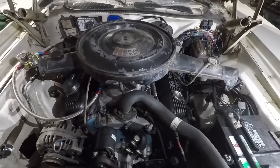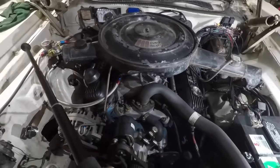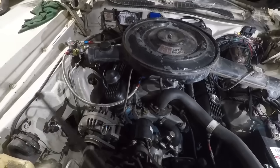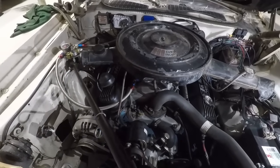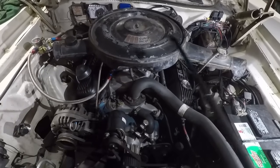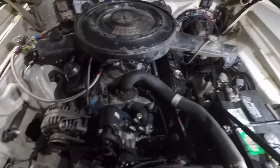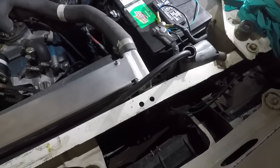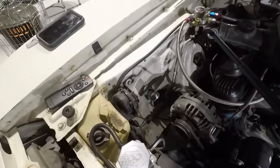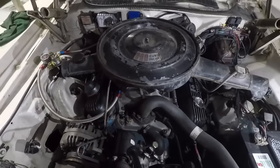Now I'll show you air filter designs that will make more power. The inlets are at least over here and here where the air is a little bit cooler. It's still pulling hot air in from underneath the hood, but this is the best setup so far. Now if you went and took some dryer ducting and hooked it up here and ran it down under the battery or up over the side, get it into the fresh air in front of the radiator on each side — now you're making horsepower. Now you're getting cool dense air to increase the horsepower of your engine.